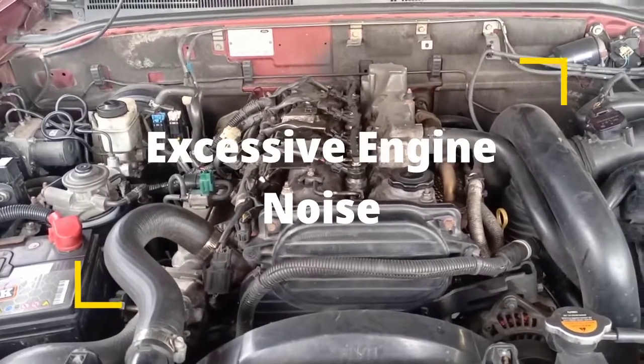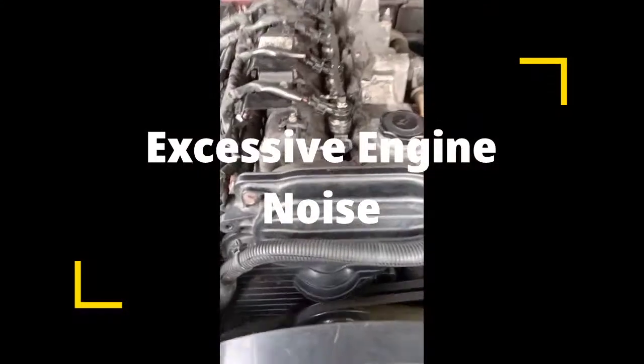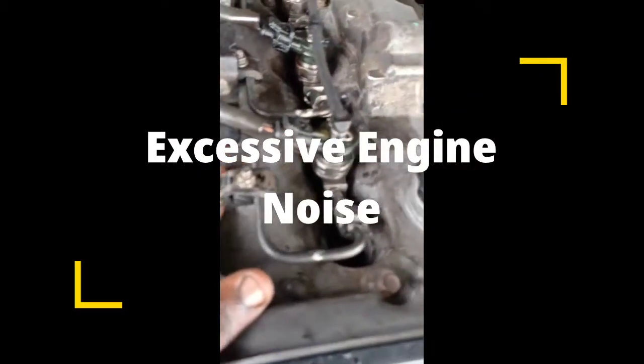So we got a good one here. This customer came in with excessive noise coming from the engine bay. He said he overheard it like the last two or three days. So we bought this vehicle and he's going to take a look at it. I'm just checking to see if any of the connectors on the injectors is slack or anything like that. He also mentioned that he's getting like a puff of black smoke coming off from the exhaust. I'm going to rev it up and see what noise I'm getting, to guide me with this diagnosis.